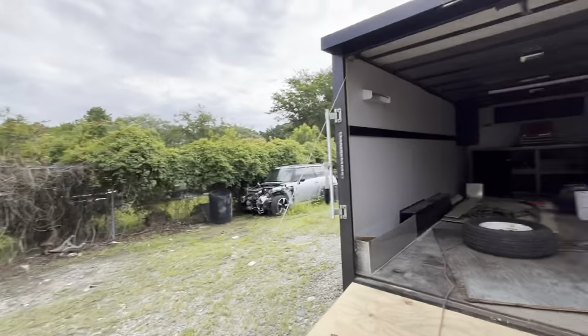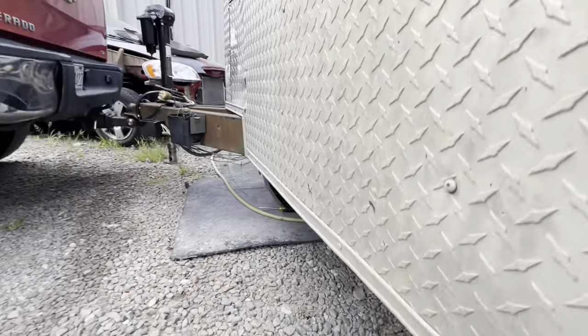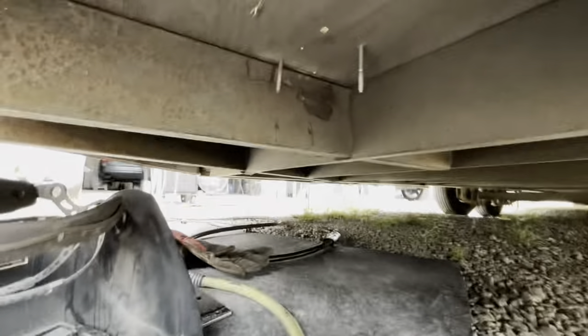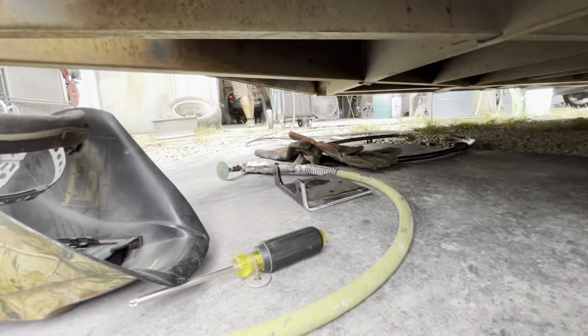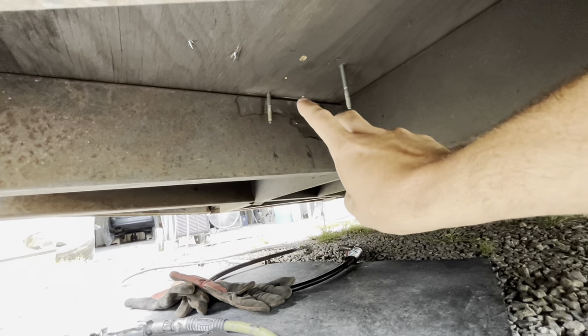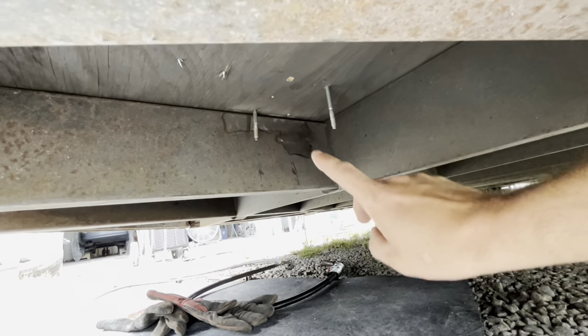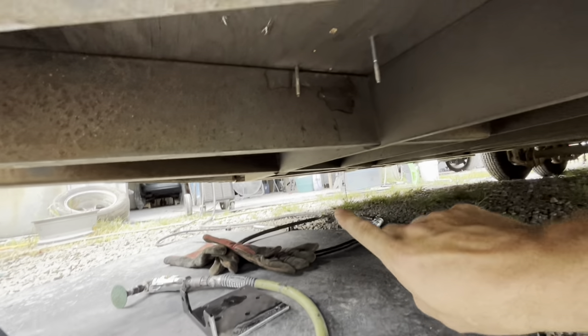This is all Mike's design — he's going to fab these up. This morning we're going to cut out what needs cutting, make some brackets, get the hinges on, and get the winch plate welded up. Then I'll have Mike hold the bolts so I can tighten it down, and I can do everything else by myself at the house. We have the winch up in the center, so I want to take the winch mounting plate that came with the kit and weld it to the bottom. We'll burn a weld down this side and down the little leg that sticks off it, then the bolts go through the steel plate into the bottom of the winch, sandwiching the plywood.